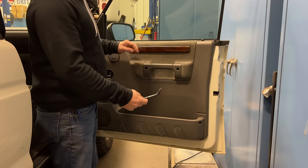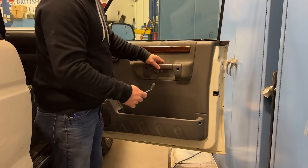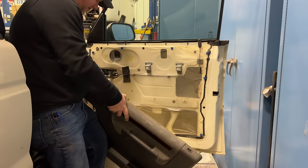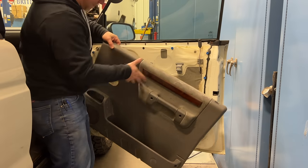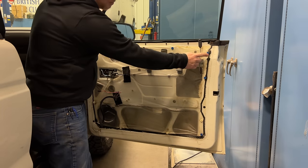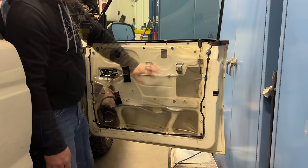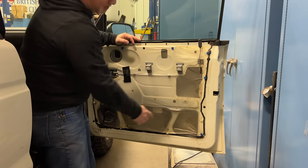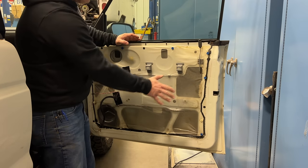Now I'll use my pry tool to try to work this top up a little bit, then start working my way around the door. There's two speakers that need disconnected, one behind here, one down here. All of these blue clips I will have to pull off and put back on my door panel before I try to fit it back to the door. You can see that this panel has never been taken off before — it's still sealed here. I'm going to just take a knife and cut a piece right here, and then I can re-tape that shut to make a good seal there again.